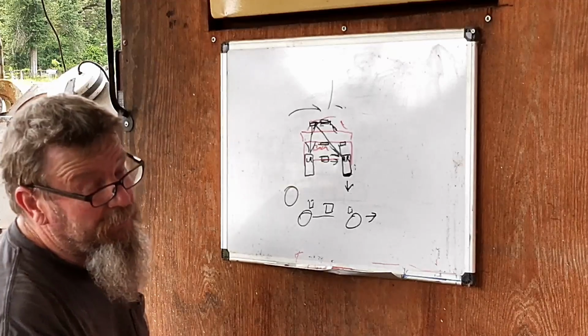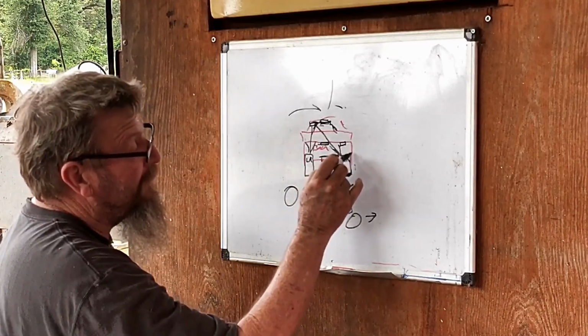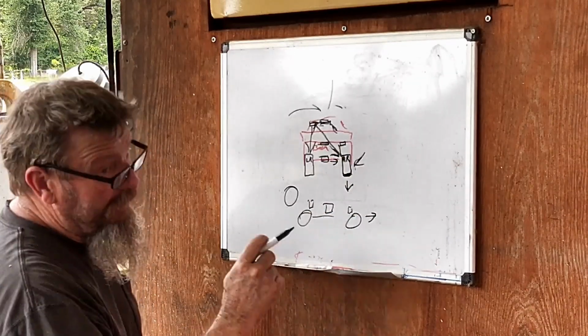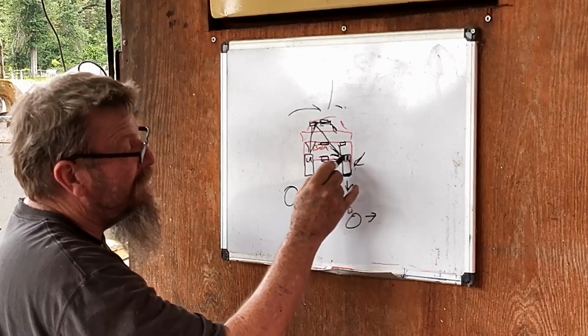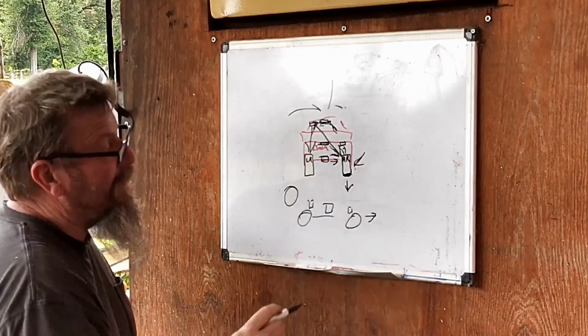The other thing is running a stiff enough spring over here that it will accept this weight. Some people are like, oh, I get a lot of body roll, but I can't get any side bite. Well, if you're running a super soft spring on this right rear and it's just tucking up in the car, you've got to be planting that tire.